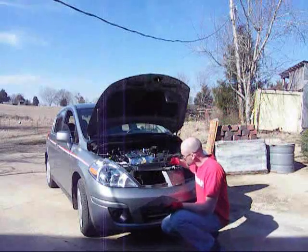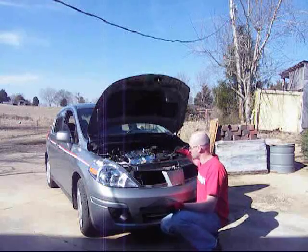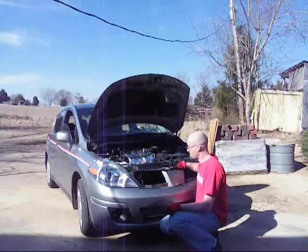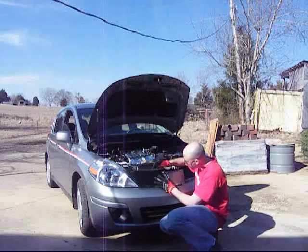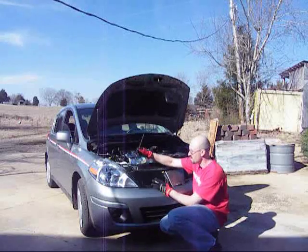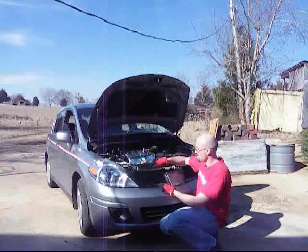Okay, now you can see I've drilled the 2 pieces here on each side. I've put this cover back on. Just remember you have 2 clips underneath the center here that needs to hold this fascia to the metal. That way it gives it support. You can now take your Versaspeed Grille, put it back on there, line up your holes, and now you can scribe your top mounting tab here and drill it, and then we can get ready to put in place.